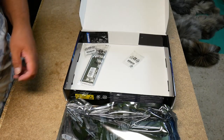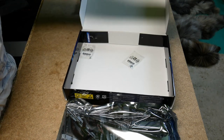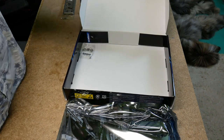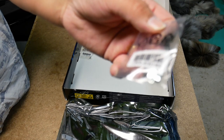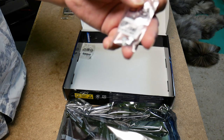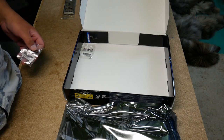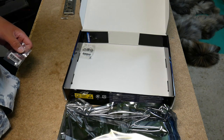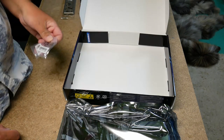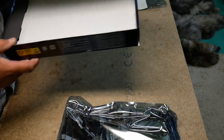And that's packing to one side for now. The back plate, which we should put in the case, let's not forget that. And then these collections here, if you use motherboard-based hard drives, M.2 slot SSD cards, and there's actually two, should open up, but these screws are needed, so don't throw these away if you buy a motherboard, otherwise you won't be able to upgrade to a faster SSD solution.